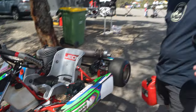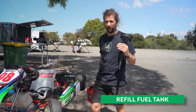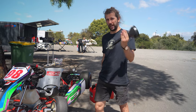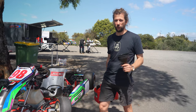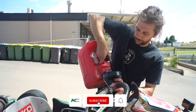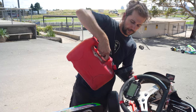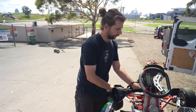The fuel's a little bit low in this instance, so we're going to add some more fuel. I'd recommend not going right to the top — when it's too full and you start to corner, the fuel starts to swish around, and if it's too high there's a chance it might come out the top of the lid and onto the driver's legs. We don't want fuel on the race suit — it might burn you. Some people have electric pumps, which is easier, but a funnel and simply tipping it in should do the job. On a practice day, not overfilling the tank is enough to prevent it leaking out the top.